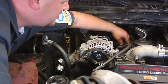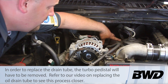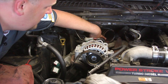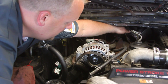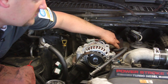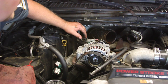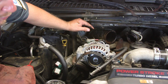Now we need to make sure that this drain tube is not rusted out — let's go ahead and just replace that. We're going to reinstall a new o-ring and lubricate it. We're going to make sure all of our flanges are good and tight and not bent. You can also now see where the three bolt holes are: one comes off the back side, which is a pretty difficult one to access; one was underneath the turbo; and one on the front side. Let's do a little more work on that drain tube and then we're ready to install our new turbo.